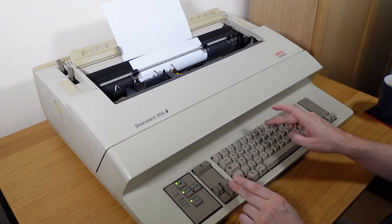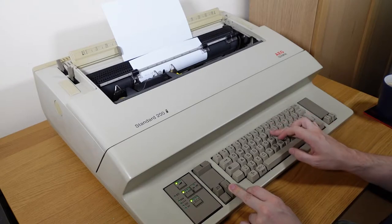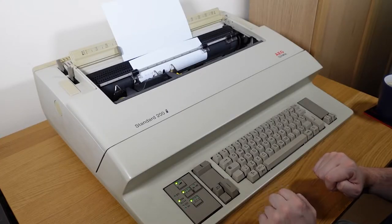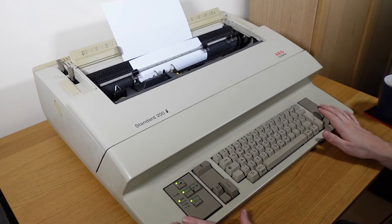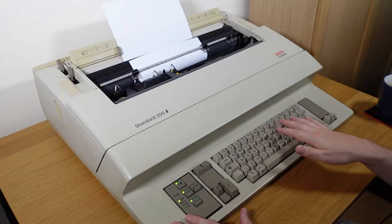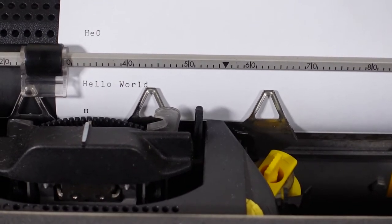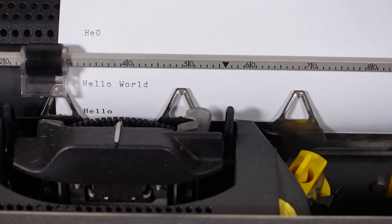Let's try bold. It's code and U, which is a bit confusing because you'd expect it to be B. But this is from the 80s, so normal conventions don't apply — and anyone coming to this was probably used to a conventional manual typewriter anyway. So let's try it again with caps lock for the H. You can see it's double-hitting it to produce the bold effect.